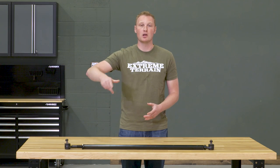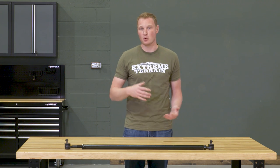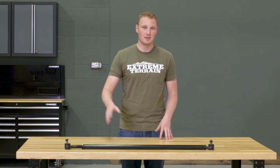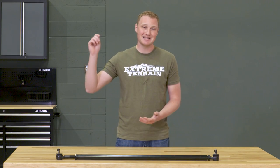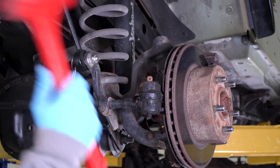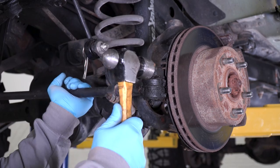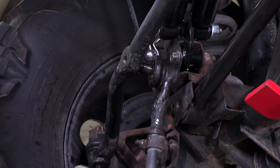The castle nut could be fused to the shaft on the tie rod end, and the whole ball could be spinning on the inside of that tie rod end, so you may have to use an impact — whether it's air or electric — to get that removed. Once you have the castle nut off, chances are, because these are a taper fit, the tie rod end is still going to be stuck inside of your steering knuckle. The best way to get that removed is not to hit down on the threaded end of the tie rod end, but to hit perpendicular to that tie rod end on the steering knuckle — that's going to be the best way to pop that taper fit out.